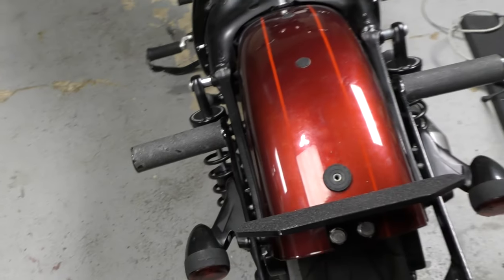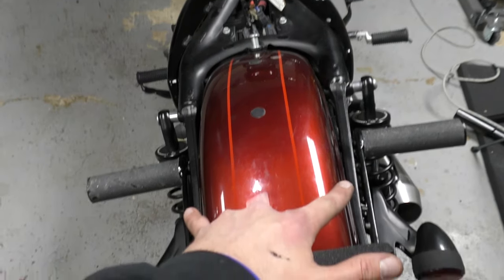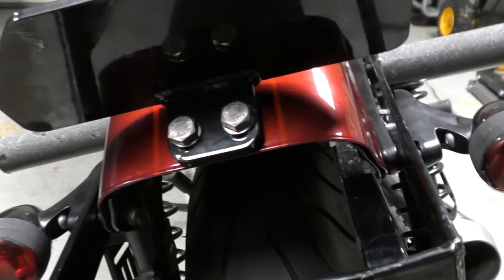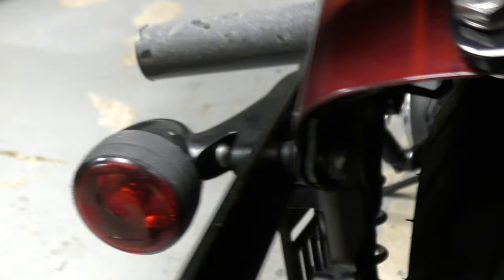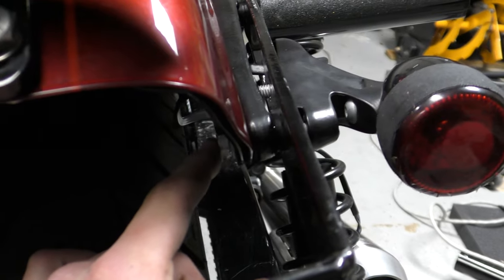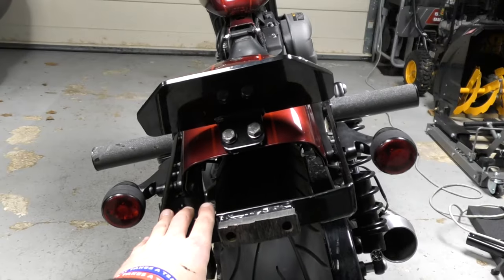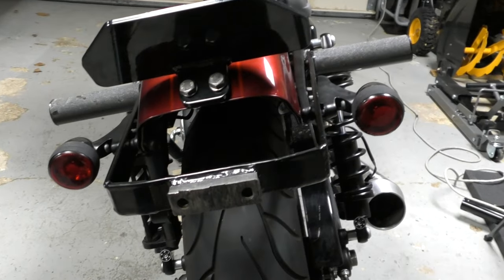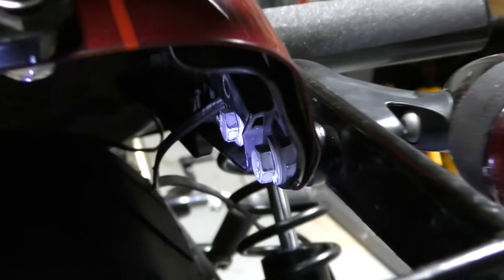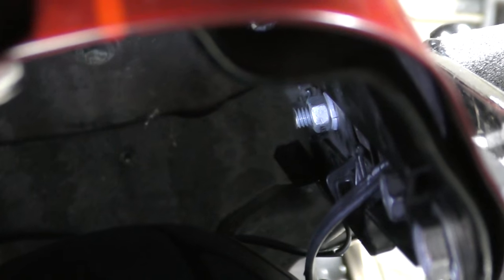The sub cage is finally on — we're just missing pucks, I have to order some more. So it's 2.5-inch 5/16-18 bolts up front. Back here is kind of peculiar — the second ones back there are 2-inch 5/16-18, and this one right here is the OEM bolt. I ended up using another 5/16-18 2-inch on this side as well. This thing right now feels pretty solid — I don't think it's going to go anywhere. I used washers on the inside for both of those, blue Loctite on the bolts, and then lock washers and nuts on each side with blue Loctite on those as well.